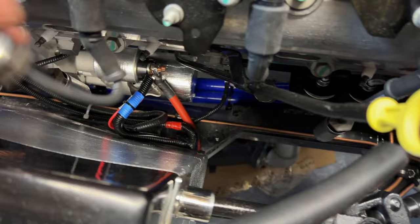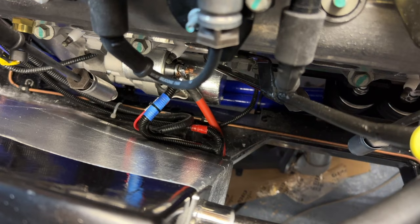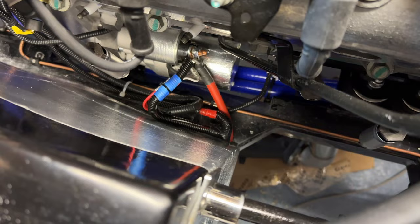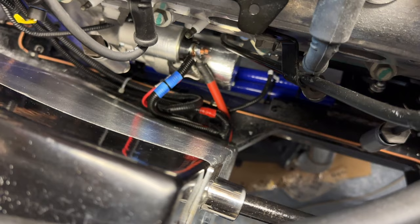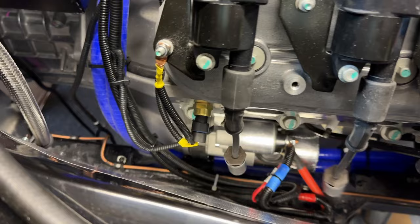So first of all, the red thick and red thick and white — they are plugged in down onto the starter motor. It's actually a bit neater than you think. I've got the AK loom and the CANEMS loom in there as well. That also needed two ring connectors connected to the pole there, so I've got a total of four things connected to the positive pole. The little white is the exciter.